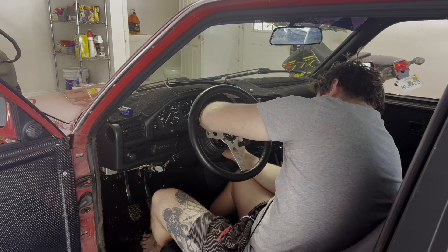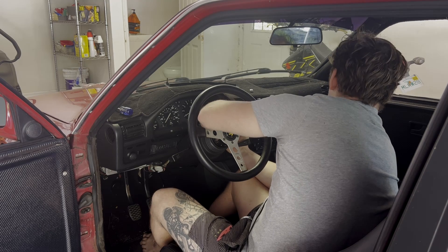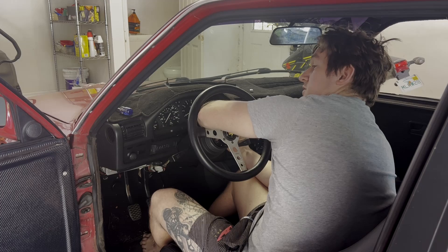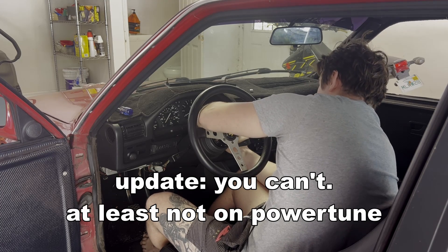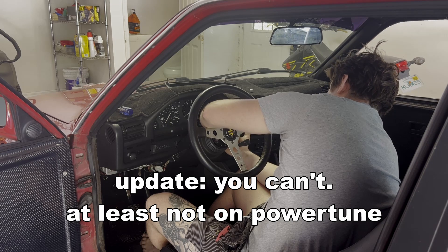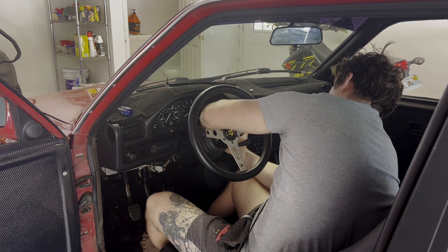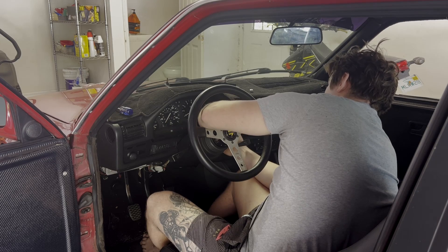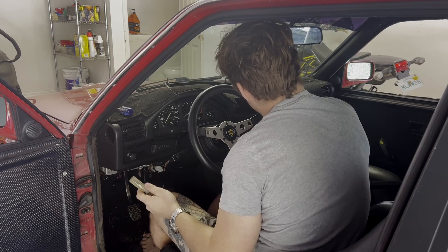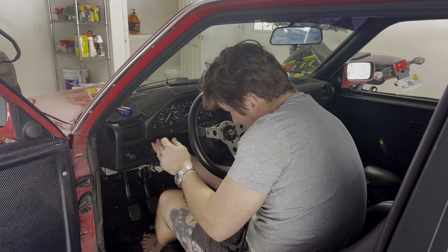It'll CAN bus to the ECU with two wires, which I think is pretty cool, and I think you can actually do some tuning on it — you might be able to load Tuner Studio into it, which would be pretty groovy. Step one is remove the old dash bezel, which involves about a bajillion finicky little screws, and we'll get to them when we get there.